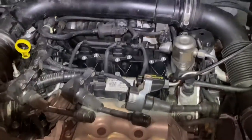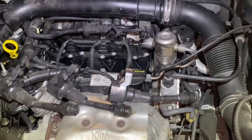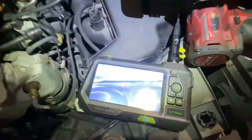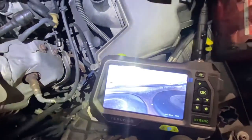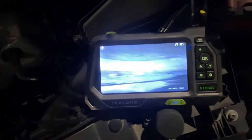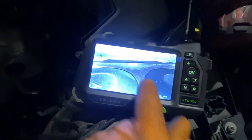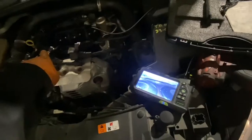I don't know whether we're going to get this as a job, but if we do it's a head gasket on a one-liter EcoBoost. Just another fast check in cylinder number three — you can see the water residue all the way around and I can see it accumulating along between the cylinder head and the actual block. This is confirmed anyway, for definite. Even though water was in number one, number three has the same kind of residue. We're condemning this thing — head gasket gone, and bad.